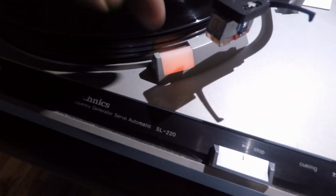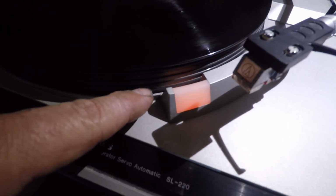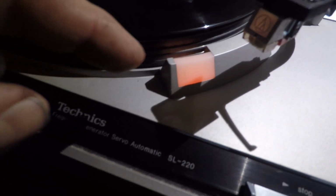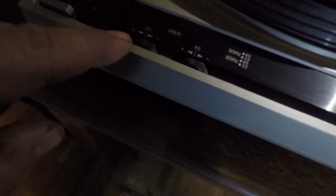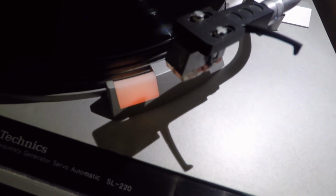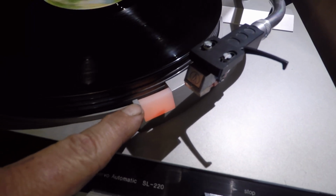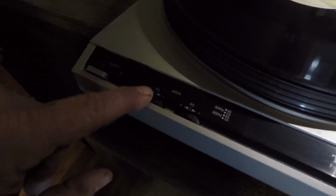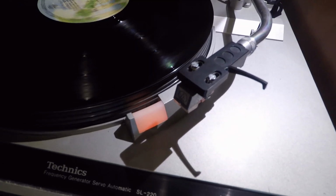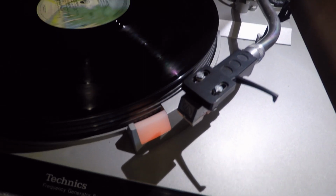Well, if you look at that very bottom row, since we are on 33s, that's the very bottom row, okay? I don't know how well it's showing up. But anyhow, if it looks like they're moving, you'll turn this knob one way and see how they start to move. I hope that's coming through so you can see it. If it's moving, you take that knob and turn it until those dots quit moving. In other words, they're stationary.